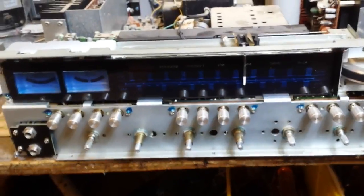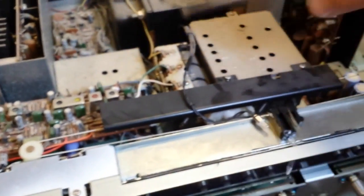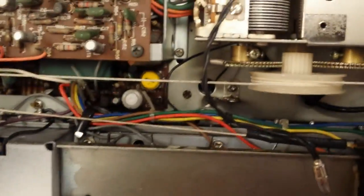Now what you have to do is tackle the lamps — this is probably the most difficult project. Somebody's already been toying with this one and they lost a little cap for the dial pointer lamp. The first thing I recommend that you do before you take anything apart is remove the guide here for the dial pointer leads. This will cause you lots of headaches if you try to leave it in there — it's going to give you more room to work.